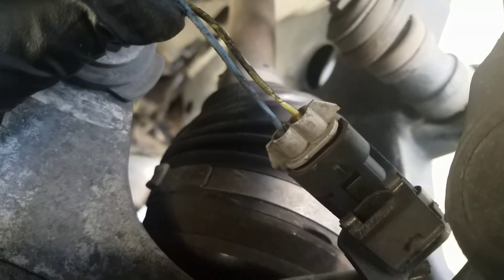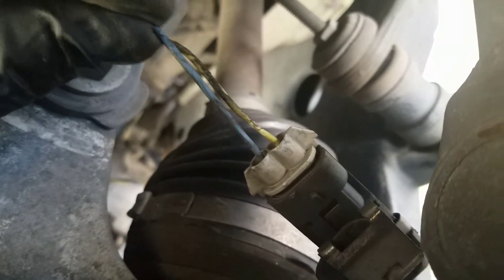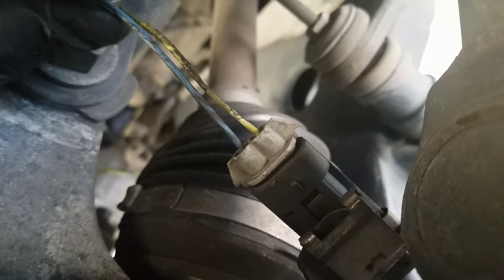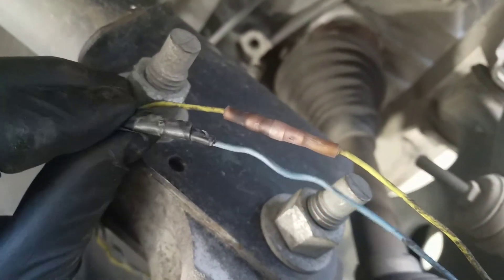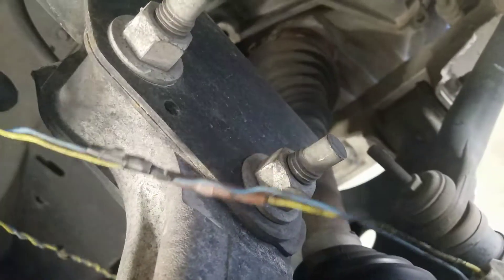See the insulation starting to fatigue and turn white as I'm stretching it — that's the pigment breaking apart. The wire is broken there on both of them, and it had a pretty low quality repair here. So we are going to replace the harness.